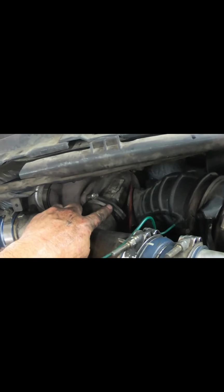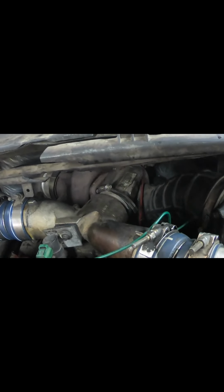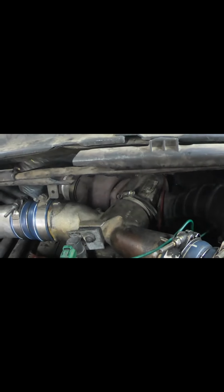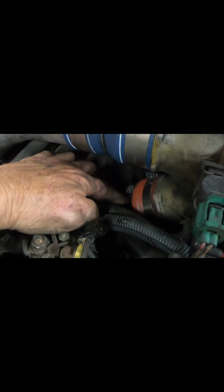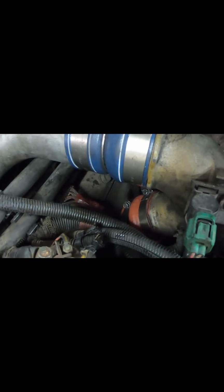So, I took that apart, shook it around a little bit, put it back together, and it stopped the leak. And I wound up, you know, didn't have a leak. Turned the pressure up to about 20. And this one down here, it got real, real loud. You could feel it vibrating. So I wound up tightening that clamp, and I went through all the other clamps.